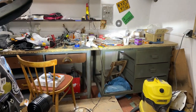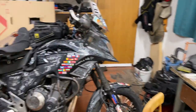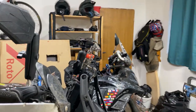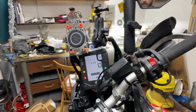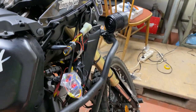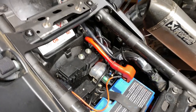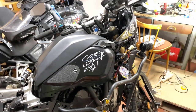That was really something I really wanted, because now my auxiliary lights — which are floodlights — go on at full power. Another thing is that the mounts are already there, so that's a Rally Raid and LSADV setup. The cockpit is kind of getting along quite nicely. I have also rerouted all the auxiliary power from the bike, which has been mounted and plugged directly into the wiring of the bike, into my own harness. I have a small tiny relay and it's powered through the battery, so no power issues on rally.